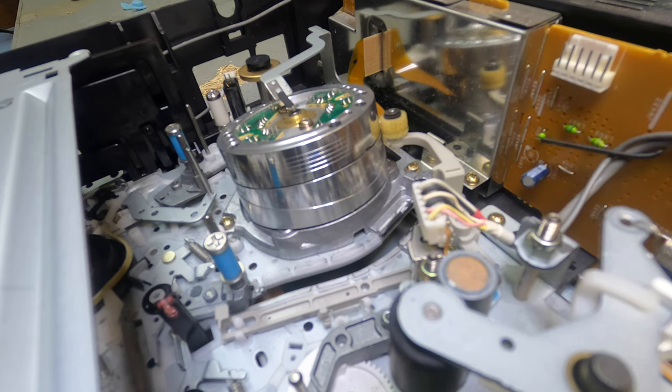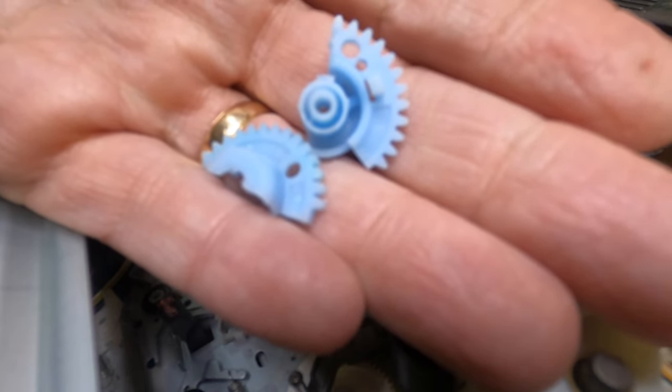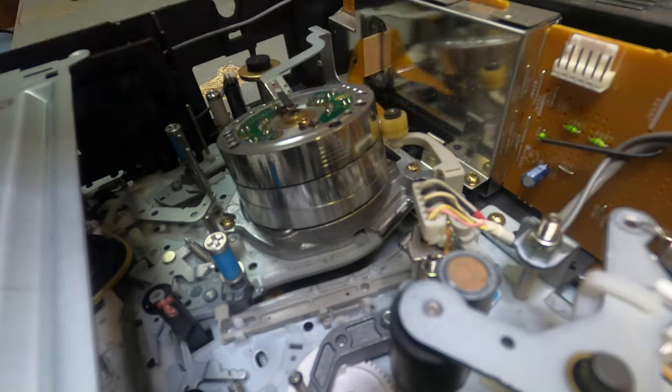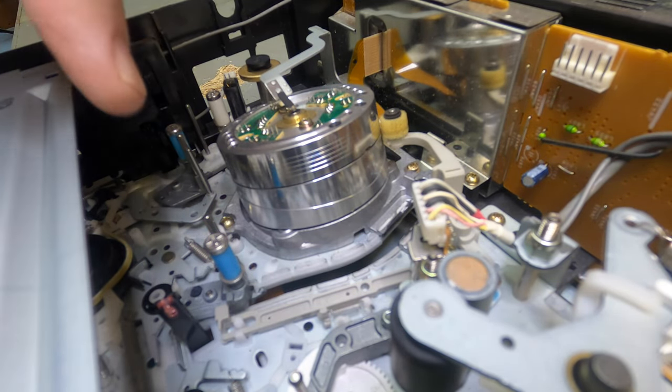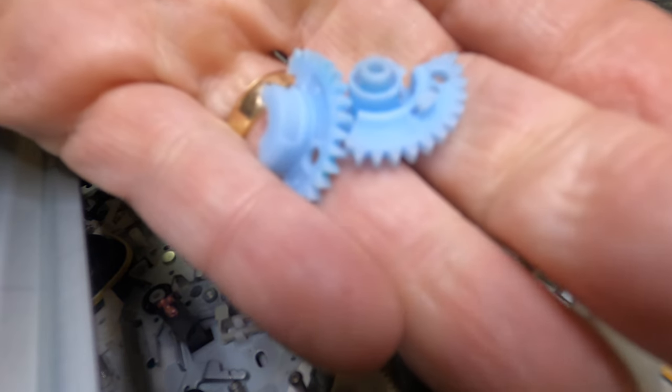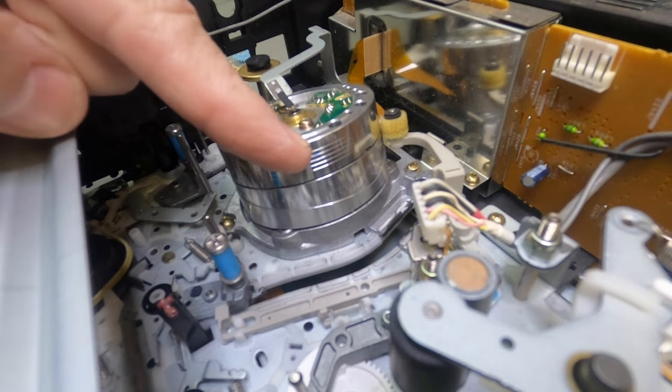You can buy this stuff online for not a lot of money. If you go to a repair shop, they're going to charge you probably $35 to $40, and you can do it yourself for very little. Don't forget — I'll leave a link below for the gear repair video. The take-up gear is a very common issue on these VCRs, so if the take-up is only working on one side, it's probably the take-up gear. That's it for me — I appreciate your time and I'll see you in the next review.